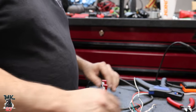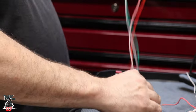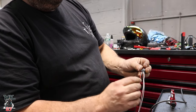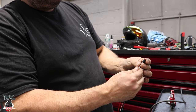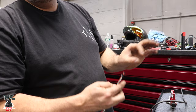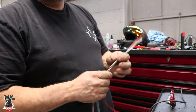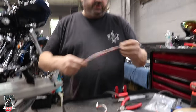It's a lot easier to do them now than it used to be. Why is that? Because with CAN bus now, your whole side is controlled by these four wires: a power, a ground, a transmit, and a receive. In the old days, you had a big plug, and probably had 12 wires in each plug, so there's 24 wires to extend. Wow. And we make these harnesses.